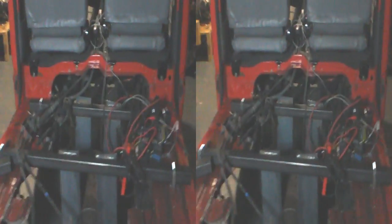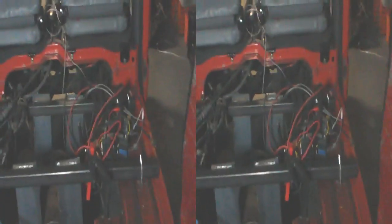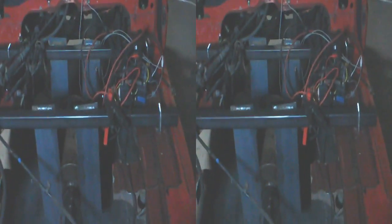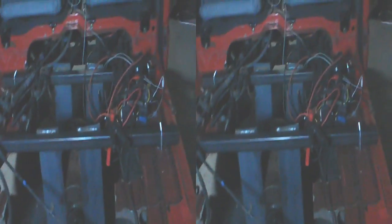We might as well use the throttle — I've got the cable back here somewhere and I can attach a switch or a potentiometer to it. I need to do the electrics — the high power electrics which have to handle like 100 amps — and get that working. Then once we've done that we can concentrate on the electronics: get the accelerator tied in, maybe get a bit of engine braking going along the line as well. It's PWM, and obviously we need a split rail supply for that, so we need the 12 volts separate from the traction batteries.